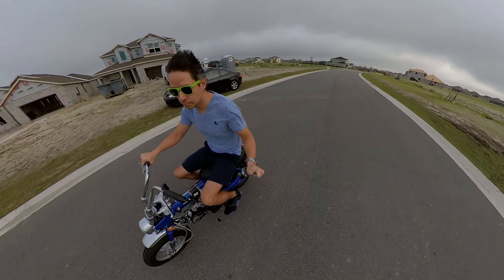A few pieces like the triple tree I decided to paint myself, but for others — like the plate that goes around the fuel tank — I noticed after the first time I fueled up the bike and spilled a little bit on it that the enamel paint came off pretty quickly. So I decided to powder coat that. I also powder coated the seat bracket and a couple of other high-use areas to prevent scratching or paint failure due to chemical exposure like gas spillage.